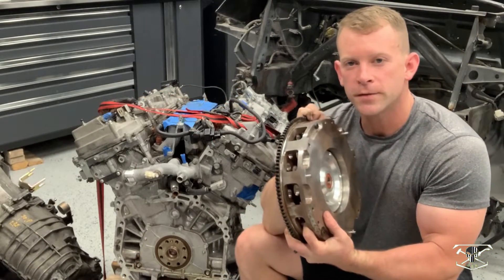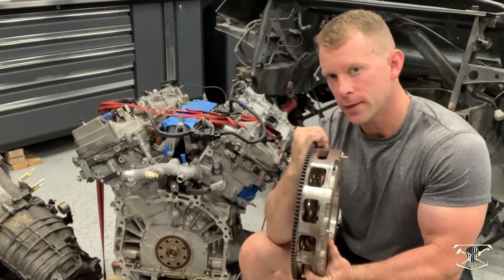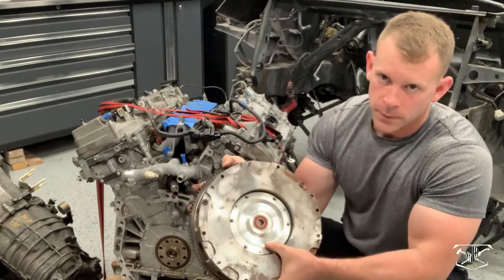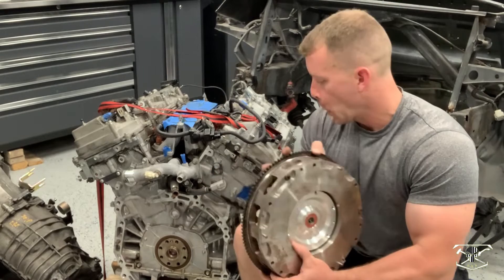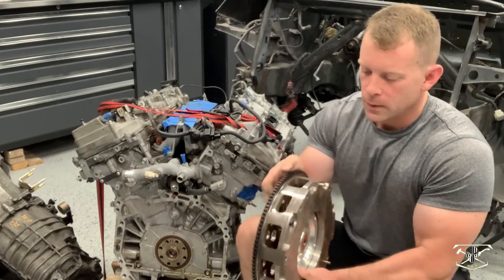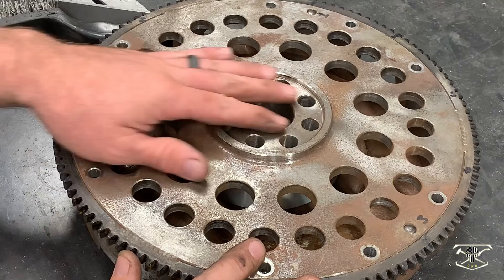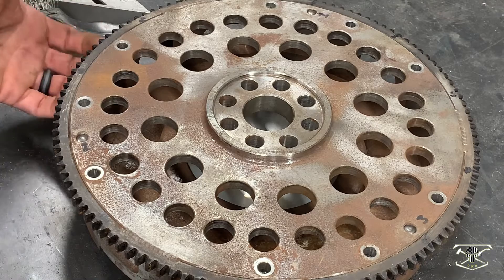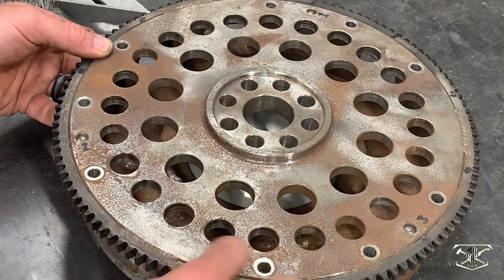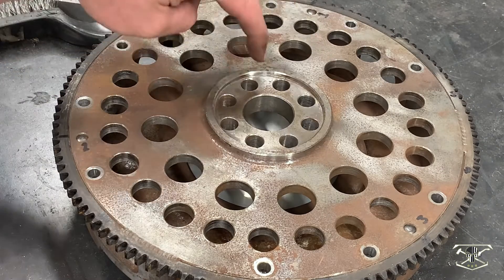This large piece of metal is the original flywheel from the K-swap series we did earlier. You can see the cage pushes it out to give you room to make your adapter plate, and it's already set up to mount to the Porsche transaxle — it has the right input and pilot bearing, and the clutch surface is already made to fit the Porsche clutch. The issue is this is the bolt pattern that fits the K-series motor. My initial plan is to pop this plate off — there are about eight bolts around the side — take it to a machine shop, cut the ring gear off the welds around the corners, and re-machine this plate to have the Toyota center to meet that Toyota crank.